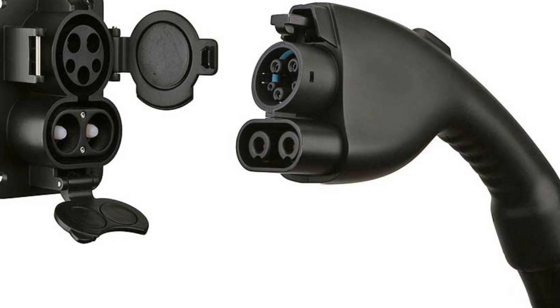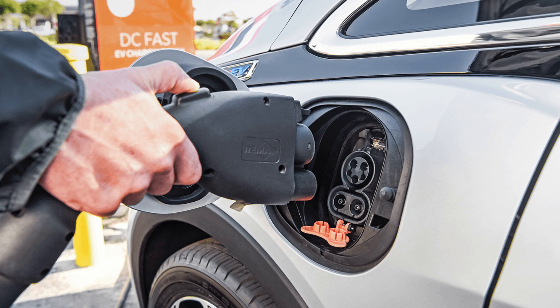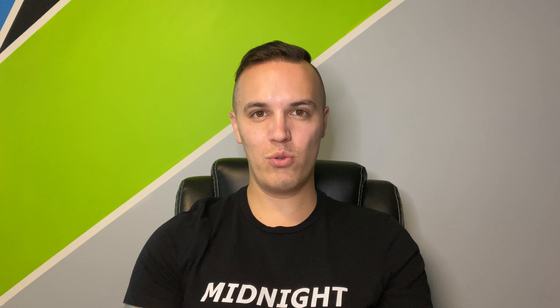The next charging standard is what they call the CCS. This is a dual charger combo — if you look at it, it kind of looks like the J1772 up top, because it is the same standard. What makes it different is that at the bottom of the CCS there is a direct current two-pin connection that connects directly to your vehicle. The majority of electric vehicles, besides Tesla and a few Nissan products, have the CCS — some as standard, some as optional. When you plug in using a CCS charger, it takes direct current, bypasses the onboard inverter, and puts electricity directly into your battery pack. This allows most vehicles to charge from zero to 80% in about 30 minutes — pretty impressive.